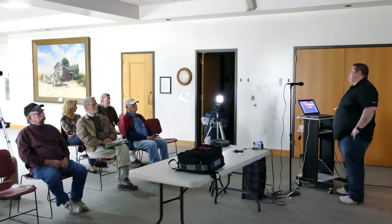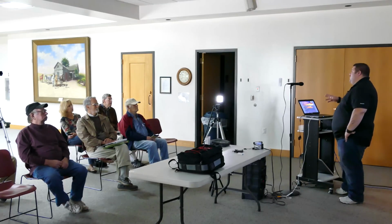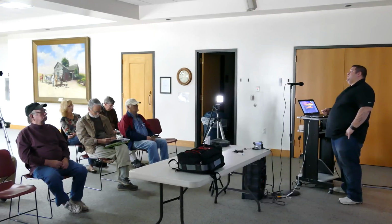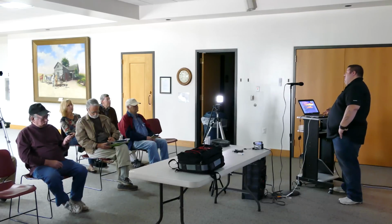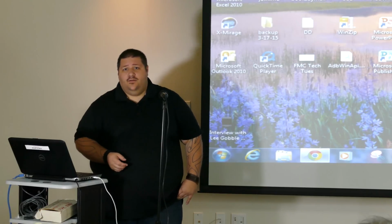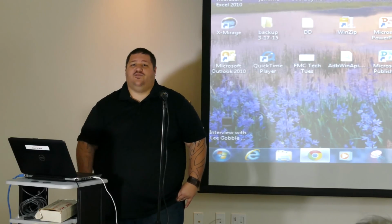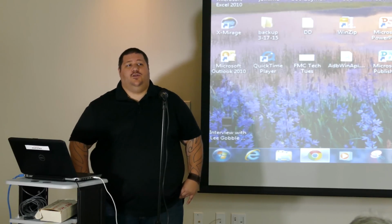Yes, sir. What is the file extension on that digital file? This particular file extension is going to be an MP4. I think some other ones will allow you to change whether it's an MPEG, an MPEG 2, or an MP4. Another thing to notice, this will also let you do audio. So if you have an audio cassette, you can plug it in only using the audio connections instead of the video connection and be able to transfer the audio that way as well. So most video grabbers will allow you to do audio as well.